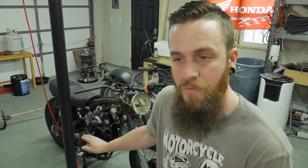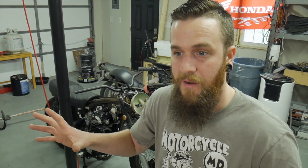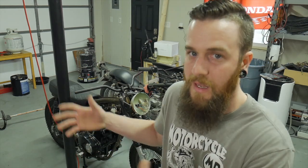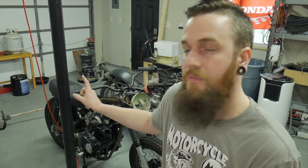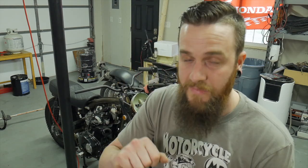One thing I also ran into was the center stand. Now that I have a smaller front tire, the center stand, as well as the tread depth on these, are a lot different than a street tire. Putting the center stand down, both tires are still on the ground. What also caused that is the rear shocks, which are from Progressive, I believe, but they are a little bit longer. So that's a fun note as well.